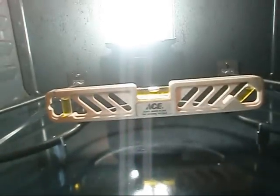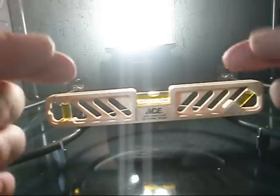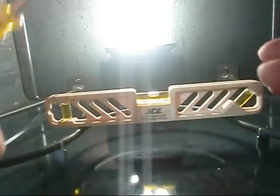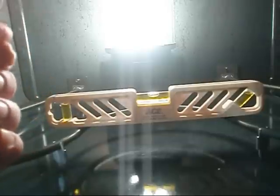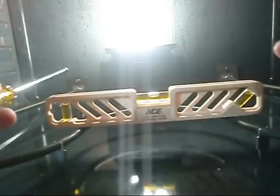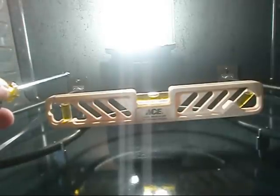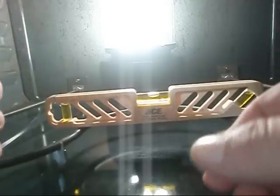Alright, so when I pulled that thing, I undid my screws and pulled it out, and my wires came with it, which made it easy. And they had flag terminals on it, okay? The right angle flag terminals. You all know what they look like. And like I just showed you on my old one, it had the straight ones on it. So I probably would have been able to leave the wires in here and plug them into those straights. However, with those flag terminals being on the 90 degree, I would have had a lot of difficulty trying to get it in them holes and possibly scrape one of my wires, and you don't want to do that. That's a potential fire right there in itself too. So what we're going to do is, I've already got started on it. We'll come back here, piece of cake.